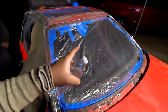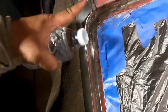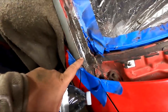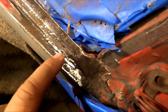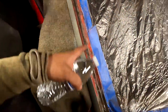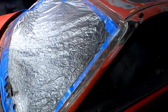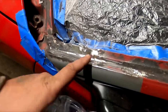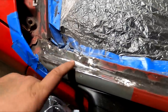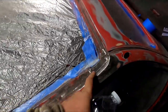I spent hours patching up all of the holes that were on the windshield channel. Let me show you guys real quick — this is the last one I just finished about 15 minutes ago. You can see that is all patched up, all shaped in, ready for some filler work on the top. Not too worried about the bottom. This right here was fortunate — it didn't actually have a giant hole, it was just a bunch of pinholes that I welded shut and grinded all down. Nothing here — this was just all light surface rust. The other side was a little more complex because we had more patches to do. You can see on this side — this was the roughly five-inch patch. You can see where I cut it, weld it all up, spot welded it back in, grind it all nice and flat — that is ready for some filler work.